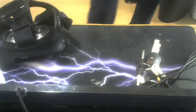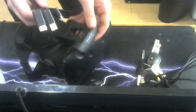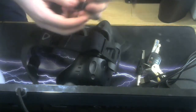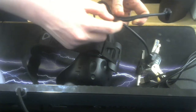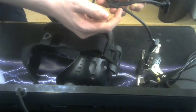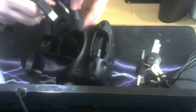With this Vive, you'd want to take your headset and route the cable however you like. What you want to do is take this connection — say you have a bad cable and the HDMI video signal is cutting out — right here, cut it. Cut right here, clean off with scissors, just right here. Or you can cut as close to the base as you can. Basically, the HDMI will be cut off, so you'll have these two remaining connectors.